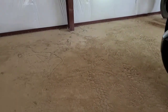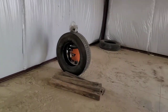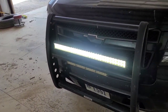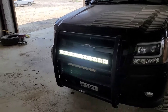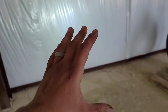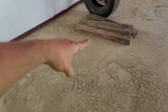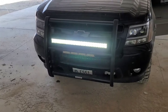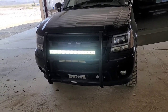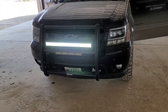That 30-inch Aux Beam light bar is starting to flicker, fade, and die. It's not a very good comparison in the middle of the day, but with any light bar of this typical design — the old rigid style Chinese knockoff — they don't focus light at all. They throw light everywhere. With it tilted back it creates a gigantic hot spot right in front of the truck on the road that almost blinds you at night. Out here you don't do any good with really bright lights for 50 or 60 feet in front of the truck if you can't see what's coming up ahead.